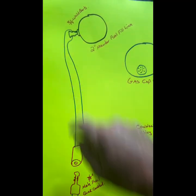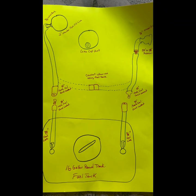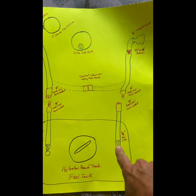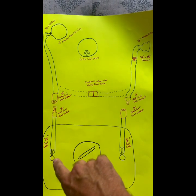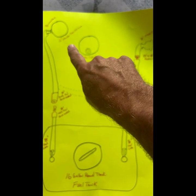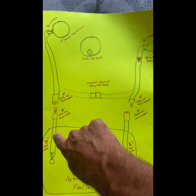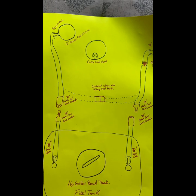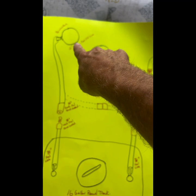That's inside your fill line of your gas tank. The basic design is you need to have a vent system coming to your rear gas tank, which as the gas is being used in the jet ski, as it lowers, it makes a siphon — a vacuum on the fuel line side — so the air comes in to the tank and goes into the fill neck.